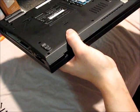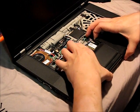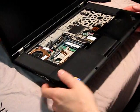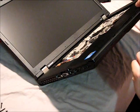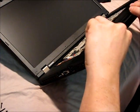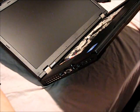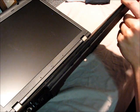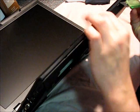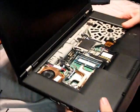I'm going to assume we're on the right track. Flip this back over — if you read the repair manual, it'll tell you first to loosen it right here behind the trackpad, which we're doing. I actually had this off once before. There are just these little latches all along the front, and you can kind of sneak your thumb in underneath there and detach those as you go across. I'll slip a little knife in there to give me a hand — you've got to go around slowly.